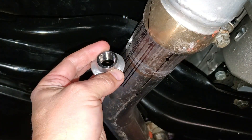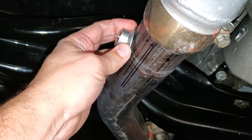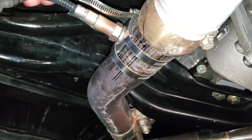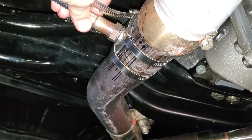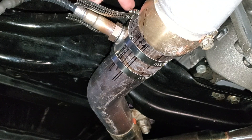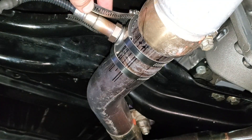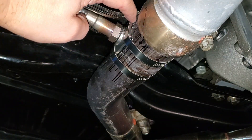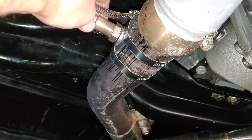Just so you guys know, the next opportunity I have when I get the exhaust out, I'm going to weld in this bung. So I could probably go a little bit bigger on that hole just to make sure I do it right now. There we have it. Make sure you can freely turn this so it's not binding on that hole you cut, so you can get it out if you need to. Make sure the screw attachments are on top — originally I put it here and then thought, how do you put a wrench on there? So fix that. I bent these up; I'll probably cut them up here. But other than that, that's good. I can see it's a nice tight seal in here, so I'm pretty satisfied with that. Tighten it down, run your wire harness, and we're good. That wasn't too bad — that was actually probably the easiest part of the whole process.